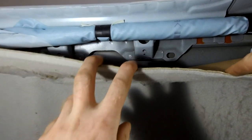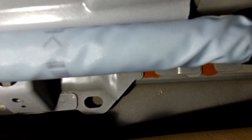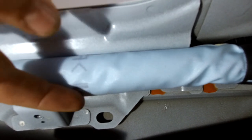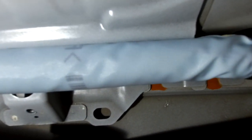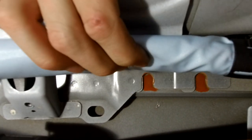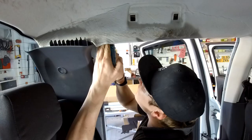I'm now lying in the back seat. Ian's coloured the drill locations in orange. If you zoom in you can see they're where the bottom two metal skins are. We only have to drill through one skin, but you can see the roof mount because it's got lots of additional material around it — so when we put the washer on it'll give a lot of strength. We're going to drill in the centre of those two orange marks. Watch this blue bag here — that's your airbag. Avoid it; pull it out the way. We'll put a bit of masking tape over it.